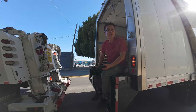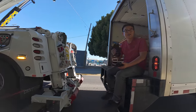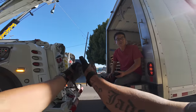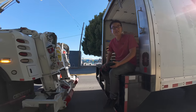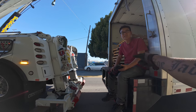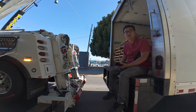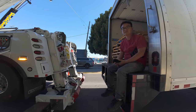But when he called me, he says it was leaning. That's why we called out this truck to stabilize it. So normally, sometimes the load does shift, and what we do is we compensate. We start moving product from one side to the other just to balance it out, just to get you to the base. The problem with yours is that we can't load that side because you have broken leaf springs. It wouldn't do no good. So this product has to be offloaded because it has to be towed from the rear.